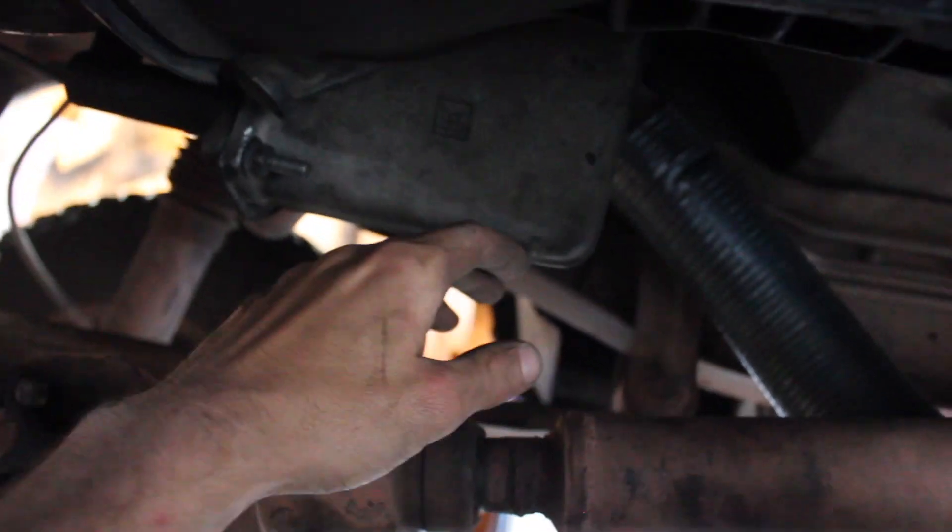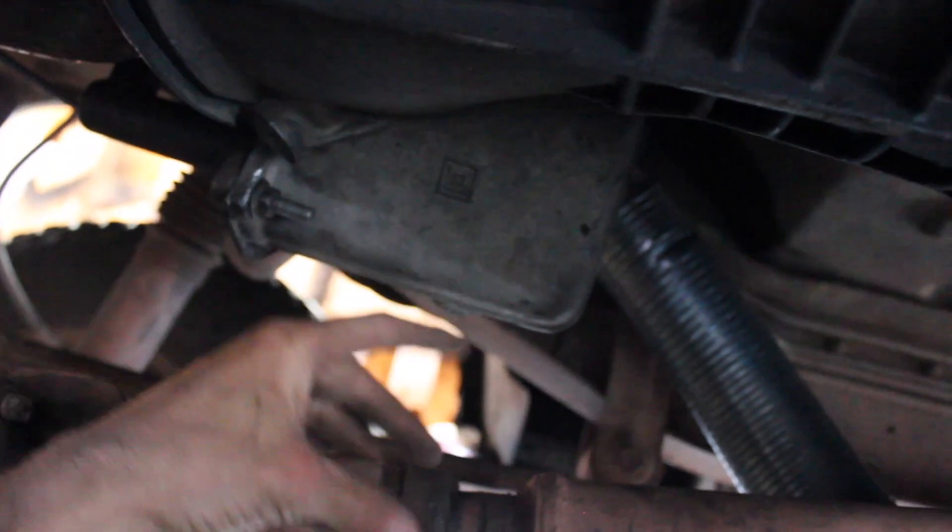So now what I'm going to do is I'm going to lift up this wheel with my jack as much as I can until it maxes out. Then I will take a look at this distance, see if the drive shaft gets any closer, and then I will take the truck with my hand and wiggle it as much as possible to try to get it to bottom out or flex as much as it's going to flex. These are leaf springs, solid front axle. It shouldn't flex too much, but I want to make sure that I don't figure out it's going to hit this slave cylinder when I'm out on a trail somewhere.